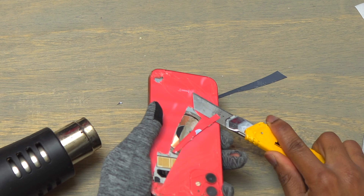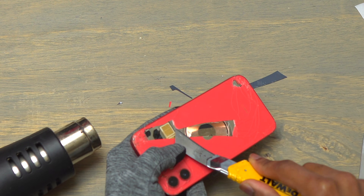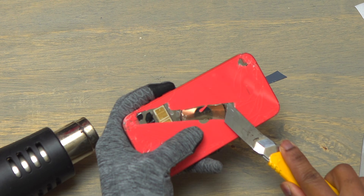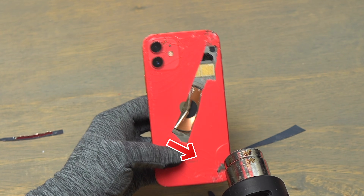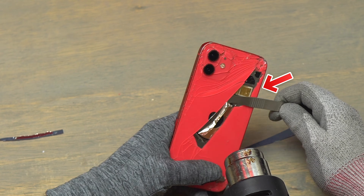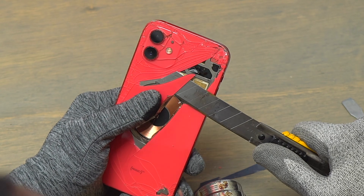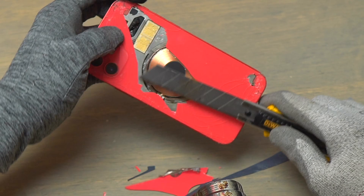While removing the glass, one thing you should not do is use a big blade like this one — it is too big and will catch things that you will not see. On the back of this iPhone 12, there are a few spots where they didn't put glue. Directly above the wireless charging coil, there is a gold-colored plastic that is not glued directly to the coil — it is glued to the glass. The other gold portion at the top right of the device is also a spot with no glue, which is why the glass in those areas came out quickly and relatively easily.